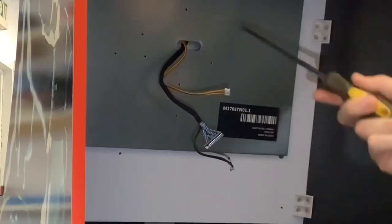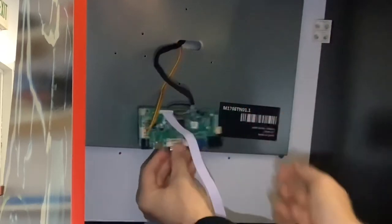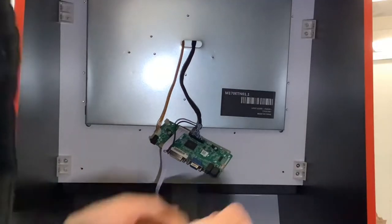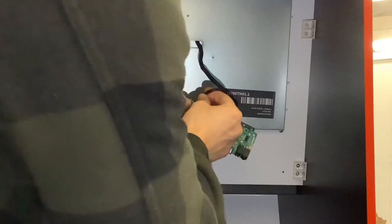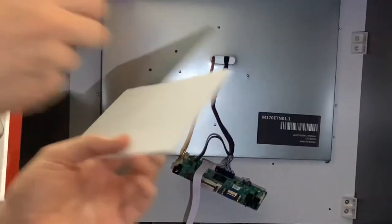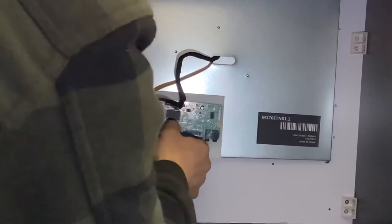The next thing I'm going to do is start installing the new LCD board. I'd like to install it on the wood — you don't want to install it directly to metal. I'm going to put a piece of foam back here. While I'm waiting for my glue gun to get hot, I'm going to install the ground wire. I'll take the screw — it actually comes with one with these LCD boards, which is nice — press it through the hole, slip the ground over the top, and screw on the little nut. So now we've got our ground. Next, I need to install some Velcro on the back and Velcro it onto the foam pad.